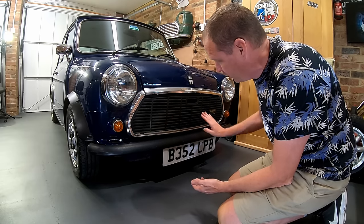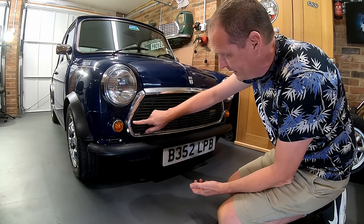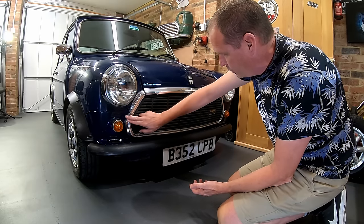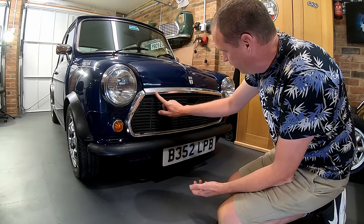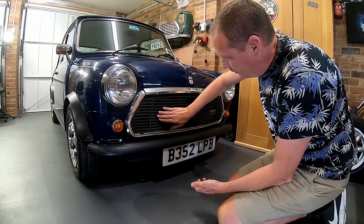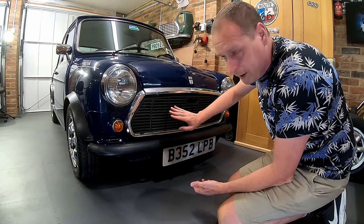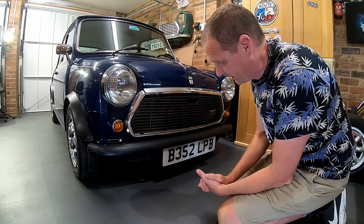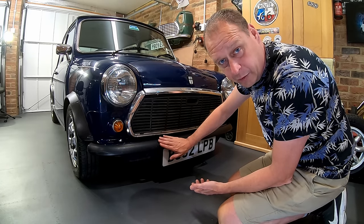So we're going to get this grill off. It looks like it needs a new mustache on this side because it's dented, and I think I explained it did have a bit of damage on this side of the car. So we'll probably have to get a new mustache end. Again, there's a bit of dent on the bonnet finishing trim at the front there, so that will need replacing. But the actual grill itself, a bit of a dent in here, which we need to straighten up. And then we're going to try and restore this grill. The original finish, by the looks of it, would have been a satin matte black, same as the bumpers. So we need to try and straighten it out and achieve the same sort of finish.